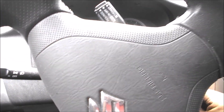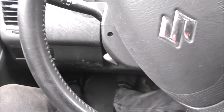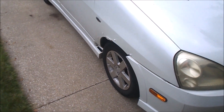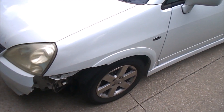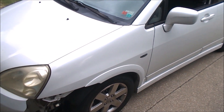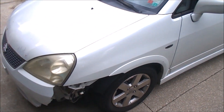Alright, bolt it back on. Let's check it out. Don't forget, your brake pedal is going to be soft — you've got to pump that brake pedal back up. That's feeling pretty good. I'm back from a quick drive. No problems on that side. That side felt pretty good too. Definitely less squeaking than there used to be. Maybe those gold pads are better than the silvers I used to get. Anyway, I think that's it for now. That's an '06 Aerio SX Premium, two-wheel drive, automatic.